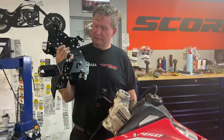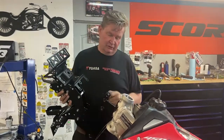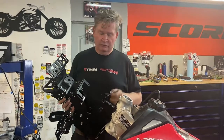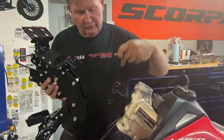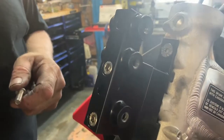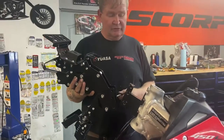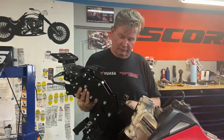Here is the tower pre-assembled from MST. I've had to go through and chase all these threads again — there was quite a bit of powder coat in there. Make sure you do that before you actually install the tower. You cannot use a bolt — you must use a chaser. You can see the remnants of the powder coat and how the threads look with the metal exposed now. That really has to be done before you start assembling this, otherwise everything's going to bind and 10 kilometers into your first ride, everything's going to be loose.